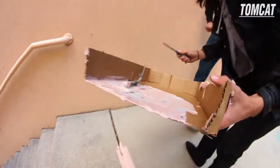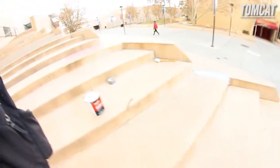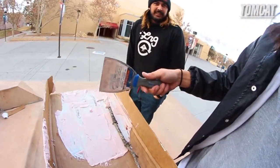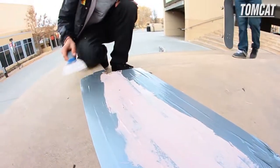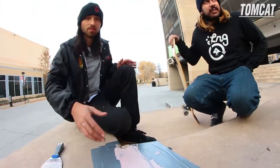Don't remix the bondo in the same container, because then the old bondo will be dry. It'll mix in with the new bondo and when you lay it down it's going to be all chunky and your cracks are going to come out like crap. Next step is finding more cardboard. You don't want to mix over old bondo because you'll get the hard rock into the new bondo and it won't be good. We didn't have to go anywhere — it was literally like 20 feet away from us. This one kind of sunk in a little bit, but it's wet. It's going to be like 15 minutes before we should even bother.